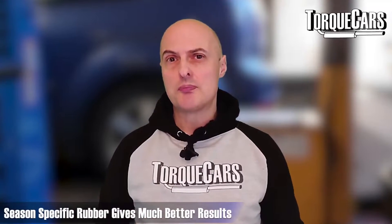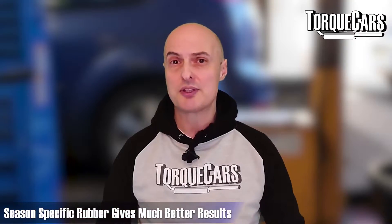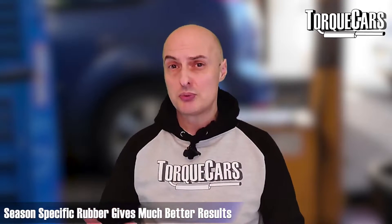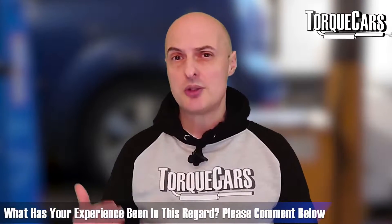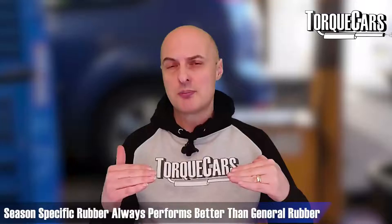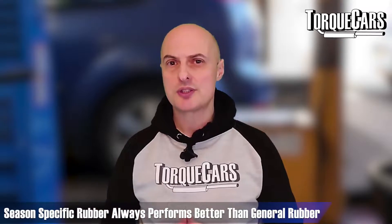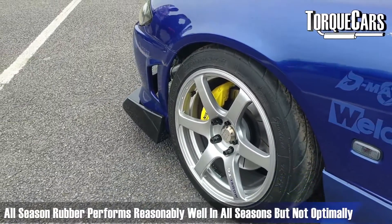I've had cars that were absolutely terrible to drive, but when I invested in a decent set of tires it really transformed them into a pleasure to drive. Think carefully about the tire — if finances allow, make sure it's tailored to the season. Summer tires in dry summer conditions will make swift progress, but those same tires in wet conditions will cause real traction loss. Conversely, a winter tire used in summer will lose you significant performance. Don't be fooled that an all-season tire is great in all seasons — it's better on average than either dedicated tire, but the summer tire is always much better in summer and the winter tire always much better in winter. The all-season just brings that average down.